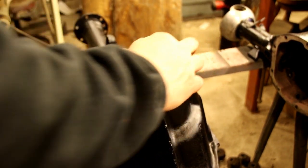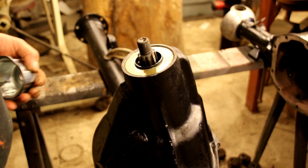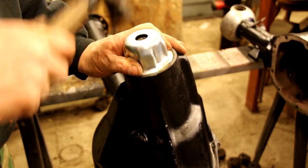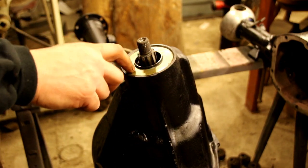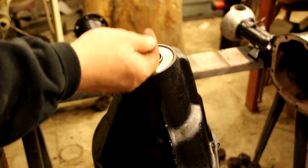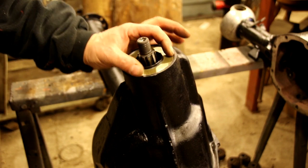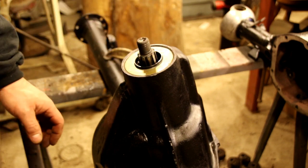Okay, when you put your seal in there, you can't just tap it flush with that. You want to make sure it's sitting on the gasket you put in there. So you could take a piece of anything that diameter, tap it down in there. This is just an old part of a tool from something that fits in there perfectly. And you just tap it down. It should be just a little bit below flush there. And you can feel it when it's solid and it's hitting your gasket. That makes sure that no oil is going to creep by your slinger, get up in there, and then start walking out the threads there. So make sure you tap that down far enough. There was a special tool available in the service manual, you can see it. But anything that fits that outer diameter and fits inside the housing, just tap that down real tight. You won't have any leaks.